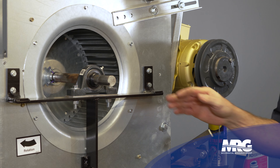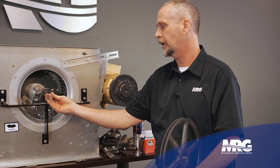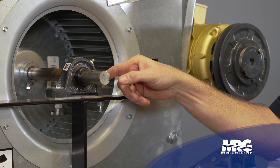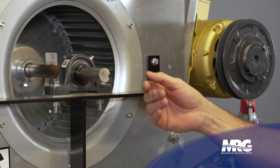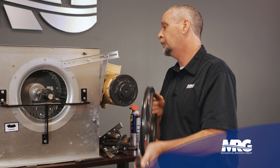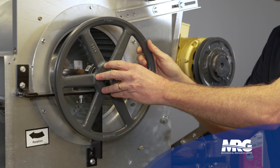You simply take it off just like that. But now — whether we're putting the pulley back on the shaft or pulling these bearings off — you really want to clean this up as good as you can, just so smooth. I don't know if the camera will show it, but there are actually little bits of rust starting on this shaft, and that tiny bit of surface rust will give you fits on that bearing. You want it just as smooth and as clean as it can be. If it's got burrs, go get a file, file it down, sand it down, spray it with your lubricant, and then start pulling your bearing off — or vice versa, if putting it back on, same thing.